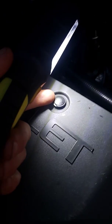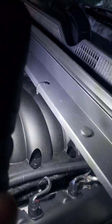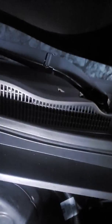Okay, number one, I mentioned in my previous one that these little clips, the same ones that hold this one on, from my Porsche did not work. You need the ones from Chevy. So I would pick up a few of these. I don't know how they sell them, because I did lose one, break one. And my temporary fix for that was a good old tie strap. It worked fine. Now, when replacing, you have to take the wiper arms off.